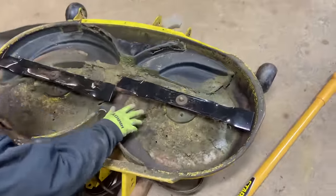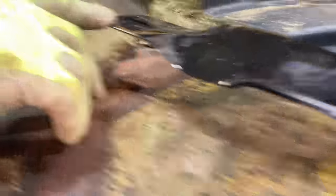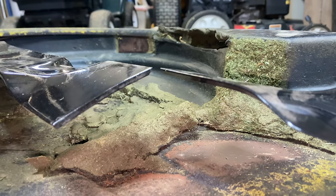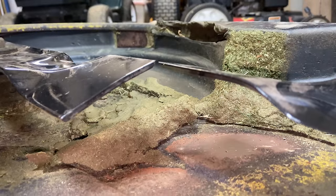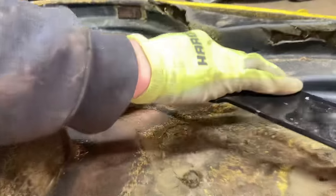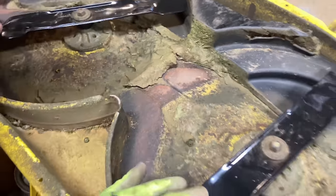After two times of removing the hub and smacking on the side, we have gotten to the point where these blades are about perfect. You can't get much better than that as far as evenness. Just always make sure you spin them and make sure we're even on all sides — and they are. Now you pretty much just have to put your mower deck back together again.